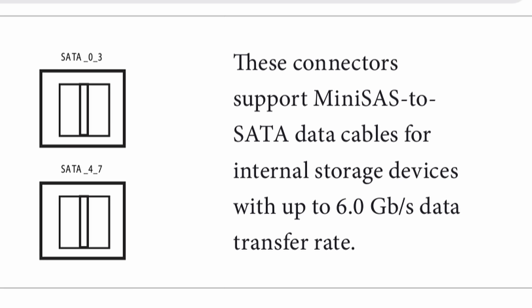After moving the world's heaviest server upstairs, removing all the drives — probably should have done that before moving it — and taking out the motherboard, I was ready to work on the new world's heaviest server. I assumed it would be an easy swap. I immediately had to reposition the plastic contact paper, then popped in the motherboard, installed my NVMe drives, got the fans connected, wired up the backplane to my HBA, and installed the rest of my PCIe devices. Pretty straightforward. I then moved all hard drives from their old non-tool-less sleds into the new tool-less NWIN sleds, then spent the rest of the night wanting to throw this system out of the window. The next day I racked it with 12 drives installed, my wife helped, added five more drives, plugged everything in, and fired it up.